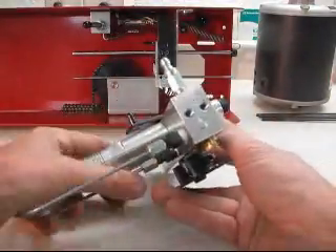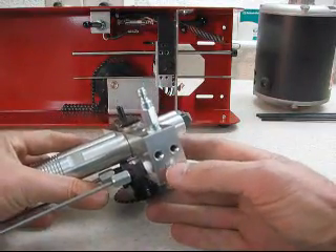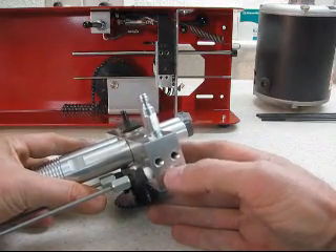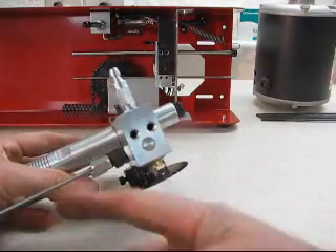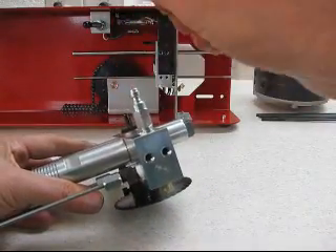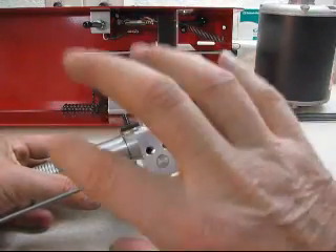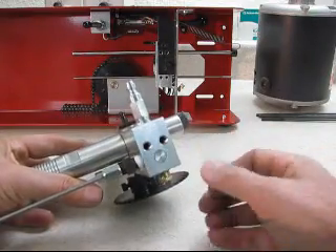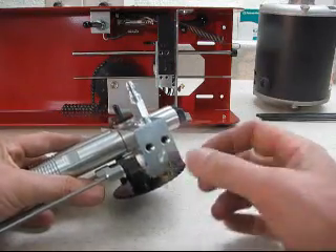Here's our assembly and the sprocket in the back. Before going to the sprocket, note there is an aluminum plug here. Underneath this plug there's an o-ring, and if there's a black o-ring under this plug, you need to replace it with a white one. To do that, wrap a heavy towel around it, put about a hundred pounds of air pressure in, and it'll pop the plug out — the towel will catch it. Examine it, replace if necessary, use a little grease, and push it back in. It all gets held in place when you bolt it into the chassis.